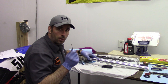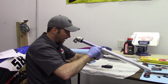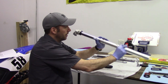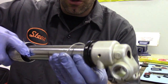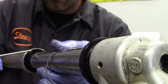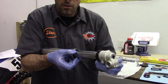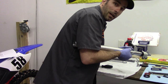Next, we're going to take a pick tool or small screwdriver and find the retaining clip inside. There's going to be a couple of notches that you can hook onto. Once we find a notch, we just pull the clip out — it looks basically like a big C. We're going to very carefully remove this retaining clip from the inside shaft of the fork to make sure we don't scratch it. Put that away nice and safe — we're going to reuse that.